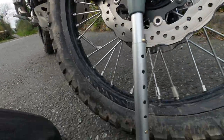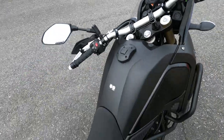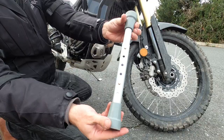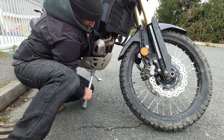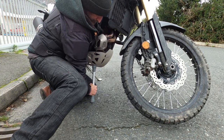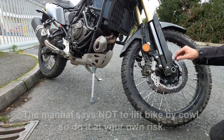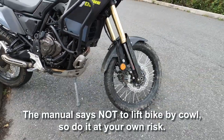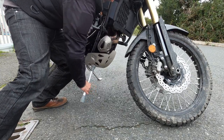And you can even — as long as you stick the steering lock on, put it in gear, and ideally put the back wheel against a curb — jack up the centre of the bike around the sump guard or the bash plate, depending on what your bike's got. I know you're not meant to do this on the Tenere; you're certainly not meant to put a lot of weight on the cowl, they call it. It's not even a proper bash plate, but everyone seems to do it and I've been doing it and it seems to be fine.